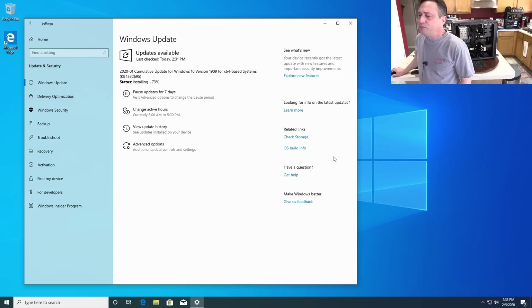As long as you're staying below where the bad RAM is located with your memory allocations, you'll never know you've got bad RAM. So whenever you're running into these weird crashes and you can't get Windows to install fresh and clean without crashing, it's usually bad RAM that causes that. So you can run memtest86, or you can just go old school, take out all but one of your RAM modules, and then do another clean install of Windows 10, see if it works. If it works, well, obviously one of the other sticks of RAM is bad. If it continues to fail, take out that one stick, replace it with a different stick that you previously removed, and start again, reinstall Windows again.